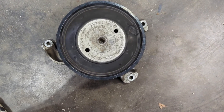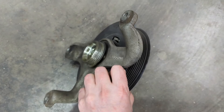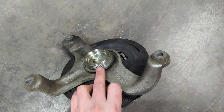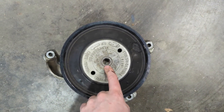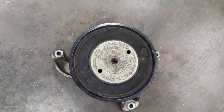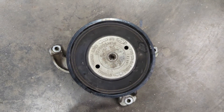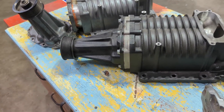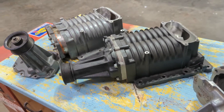The Lightning and the Harley pickup have the same caged lower. This can be a real bearcat to get undone — it's reverse thread, and it's quite a bit larger around than the piece you have to actually drive it off with. The important thing is it's the same size for a Harley and a Lightning pickup. A Lightning from the factory, you're talking something like 13.7 quarter mile — pretty tough to work it down into the low thirteens from the factory.